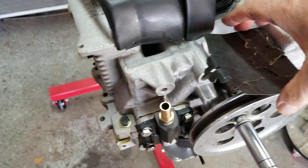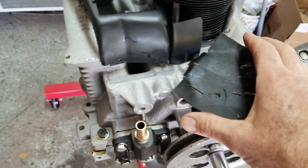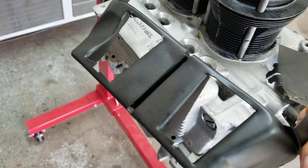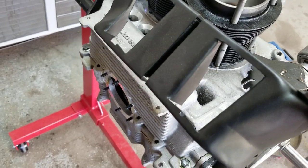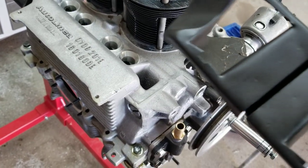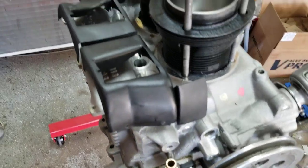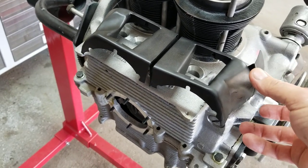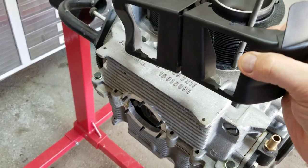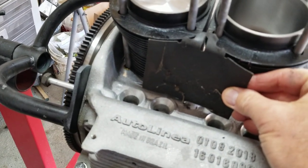So normally underneath your cylinders on your type 1, you have one of these. On type 3s, they have this type of cooling system. Some people will say that this does not make it run cooler, but it actually does. I'm going to explain this real quick again, even though I've explained it before, because somebody might be a brand new person watching. You guys who've already seen this, please be patient for a minute, or you can fast forward a little bit. What these do is replace those deflector shields that normally go between the two cylinders underneath the engine.